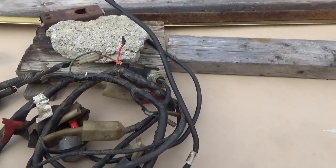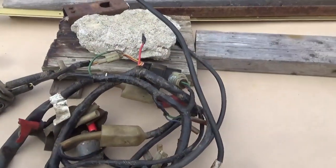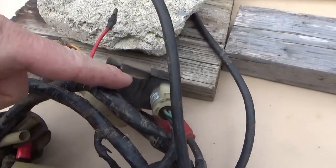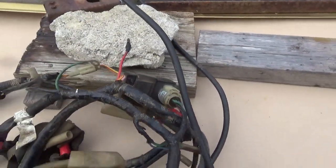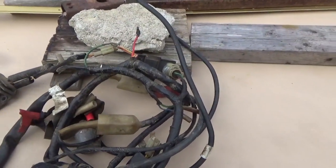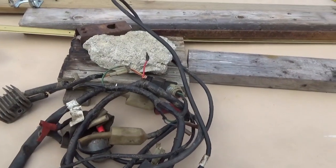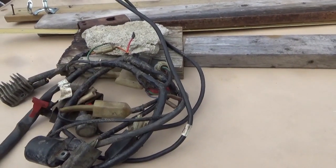I messed with it more and got intermittent spark — it was just being fussy. This is the correct CDI for a 200 ES, which is important — it's different than the M and different than the E. You actually have to use a 200 ES ignition. I swapped that out, same thing. Swapped out the coil, same thing. At some point you just have to say: hey, 40-year-old ignition components — we've got to do something different.